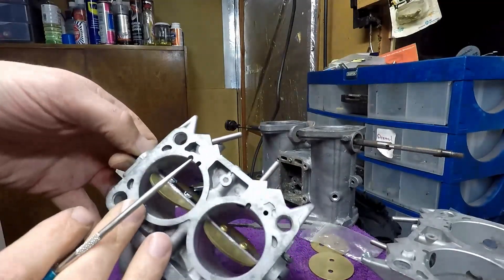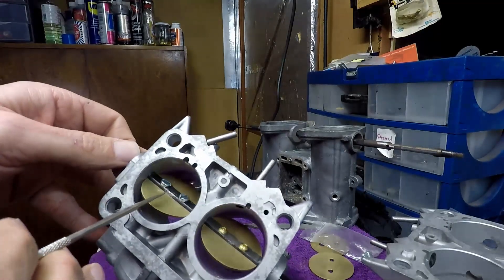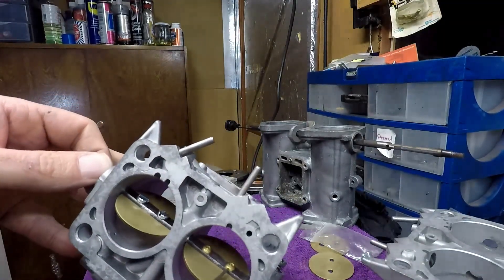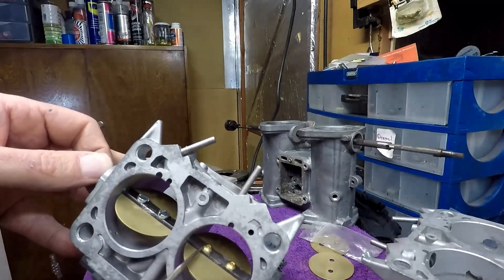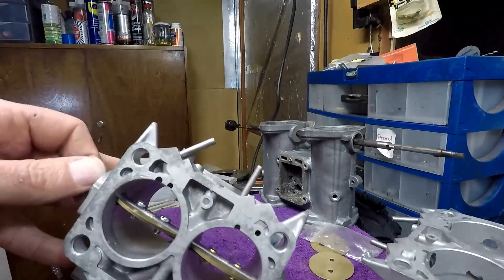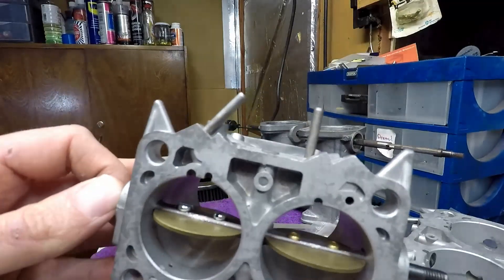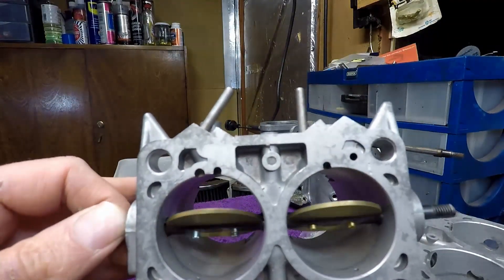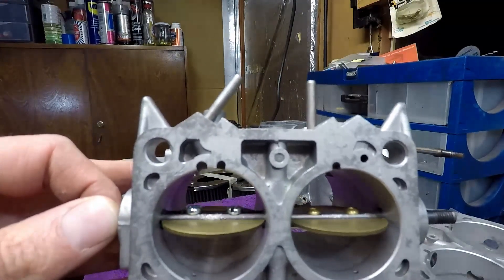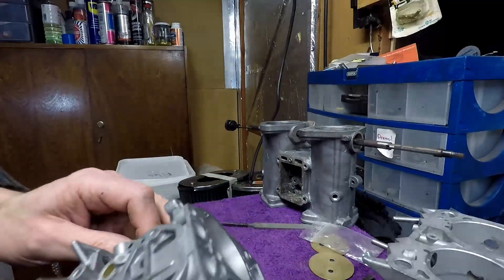What I've done here is one versus one so you can see the difference. In the standard throttle shaft there is a ledge here, so I filed that away and I've used different screws — these are the original Italian screws and as you can see they protrude less. I'm going to file that even further so it presents less of a restriction. If you look at the difference between the two, it's very clear — this side represents much less of a restriction than that side.